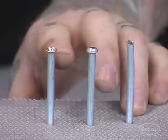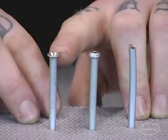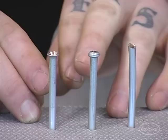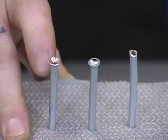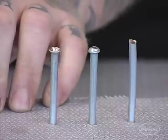Here I have two lines I cut with a hacksaw and two that I actually flared properly. On the hacksaw-cut ones — one is a single flare, one a bubble ISO flare — you can see the single flare is mushroomed and not flared evenly. The bubble flare has a rough edge, so all that debris is right around the sealing area. When you go to seal it, that's not going to be a good contact area and will cause a leak over time, eventually causing fluid seepage and a mushy pedal.